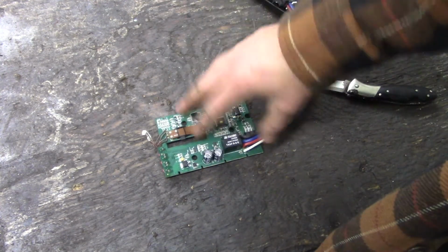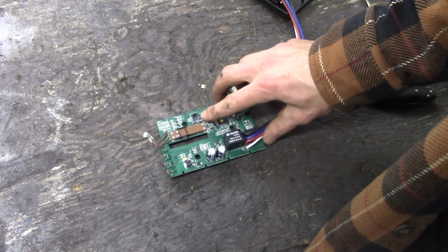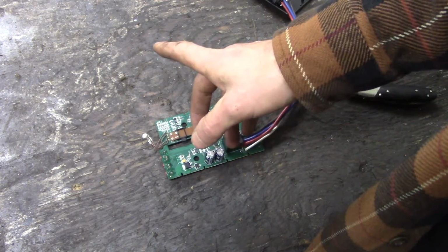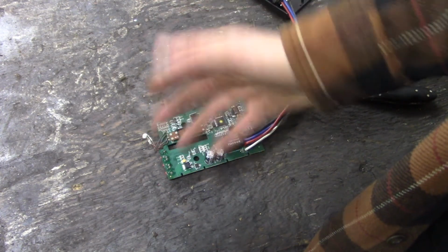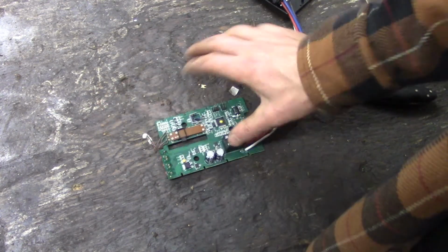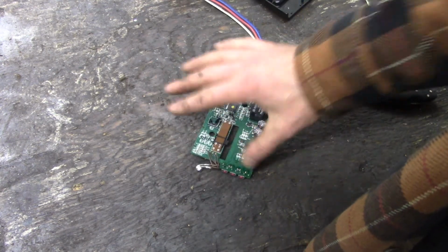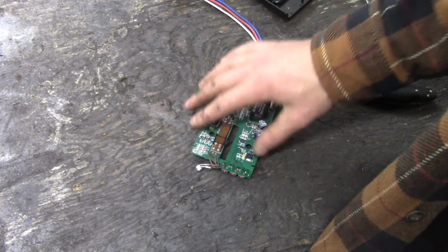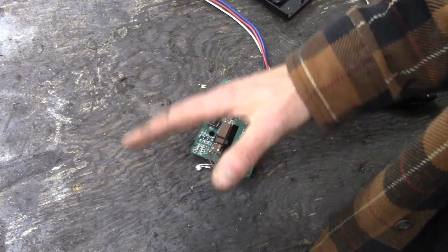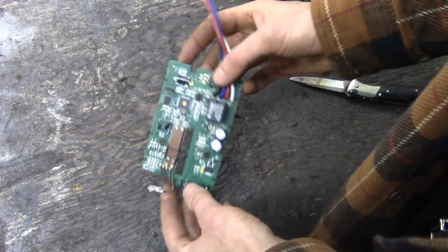Really, I think the best controller, I've never used it, but there's something called a Brake Smart controller, I think. There's a little pressure transducer that taps into your hydraulic brake line, and that is what reads the amount of brake pedal input rather than some stupid accelerometer electrical thing. And I think that's a pretty sweet idea. There are a couple different companies that made it. None of them are available anymore. I don't know why. Tell me why. I think it's a great idea. Maybe it's more expensive. I don't know.